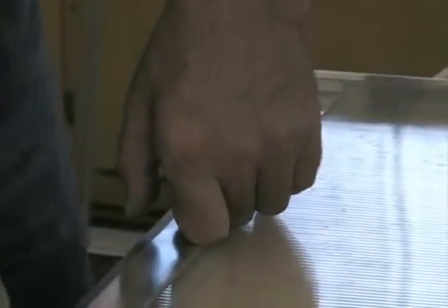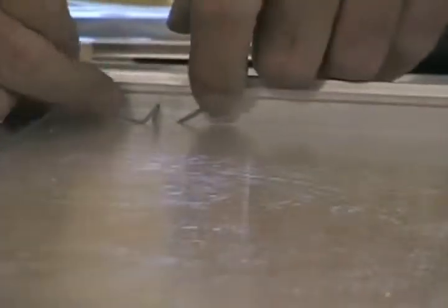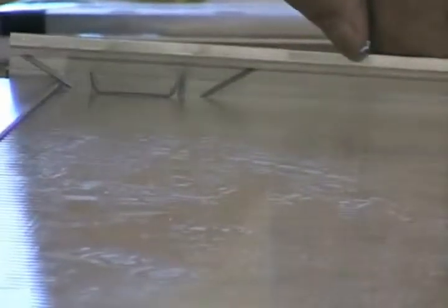We'll slide the unit up, and then the plate should drop down nicely inside the lip of the front latch plate. Now to retain this in place, we're going to take the clips and install the first of the clips, like so. Note the position of the clip. We want it down near the front end. That will retain everything and hold it all down tightly on the seat. I'll show you again in close-up how we do this.